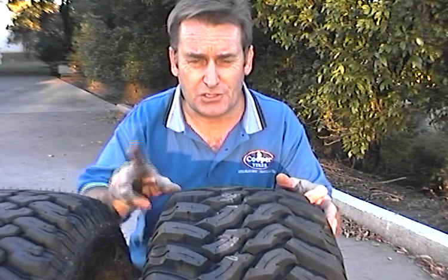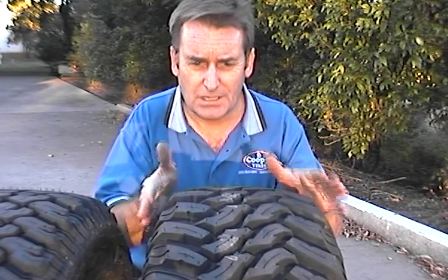Today in radial tyres, 2 plies is the most commonly used. Cooper use a 2-ply construction in their all-terrains and their highway terrains, and they use the highest denier cord. A 2-ply Cooper is as strong as any 3-ply 4-wheel drive tyre in the marketplace. You don't need 3 plies to get the strength, you just need the really strong cords. So when Cooper decided to make a 3-ply tyre, they made it different. Let me show you what they did.